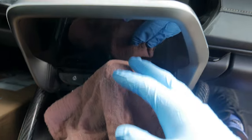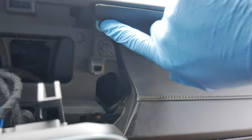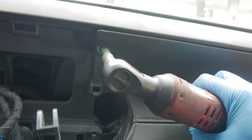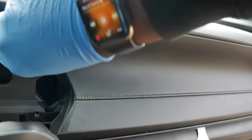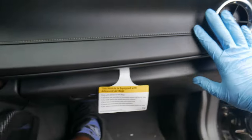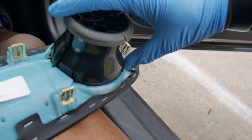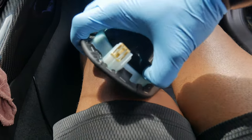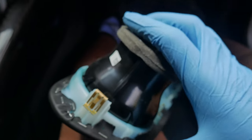Alright y'all, so we got the rag covering the middle part of the shifter and the radio is just resting on it. Now literally the only bolt we need to touch is this bolt right here behind the leather — I think it's a 7mm. Undo that bolt, make sure it doesn't fall. Once you undo that bolt, this panel is literally just held in by some clips. Use your panel popper and just work out this whole panel and it should just come out, including the air vent — there's nothing to disconnect. Now to get the vent out, there's just four clips, you just push them in and work your way around. Make sure you don't break any of the clips. Once you get those clips to undo, the whole vent will just fall out of place.